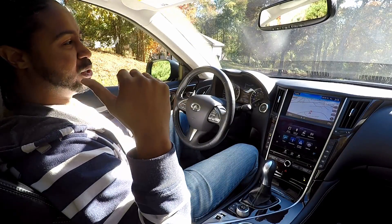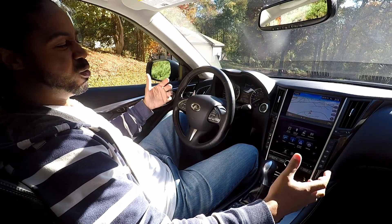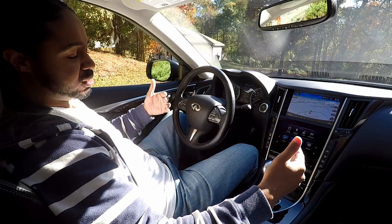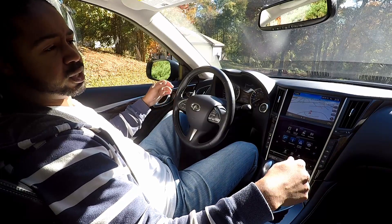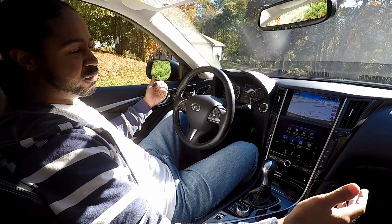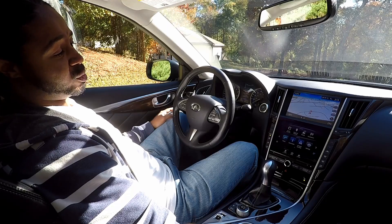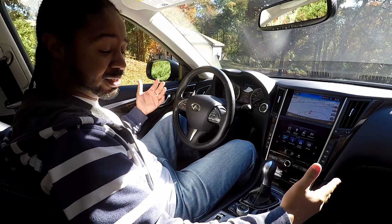So instead of giving you that option, they kind of just always do it now. Snow mode on this car is basically just for rear-wheel drive guys — all it's doing is desensitizing the throttle so it makes it harder for you to spin out and you get a smooth steady start. It ain't really doing much. Snow mode — I personally think it's useless, at least on the Q50s.